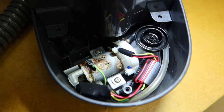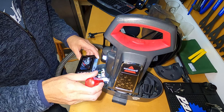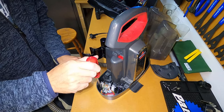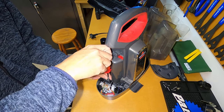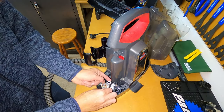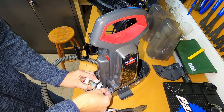What we're looking at here is the hose clamp just at the bottom of my screwdriver there — that's what we want to loosen off. The only issue is that the hose clamp is mounted in a position that I can't get my pliers in to loosen off. So what I'm going to have to do is just remove this pump, lift that up, and then hopefully we've got better access to the clamp. With the two pump screws removed, now I've got better access to this clamp here.